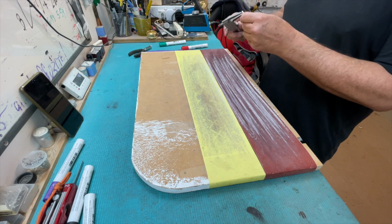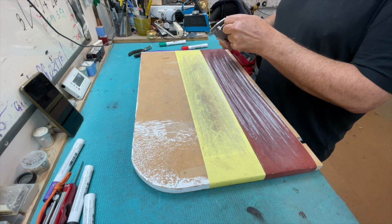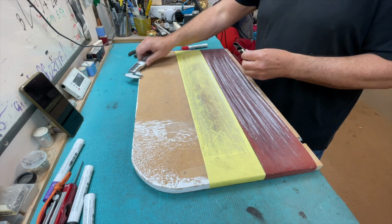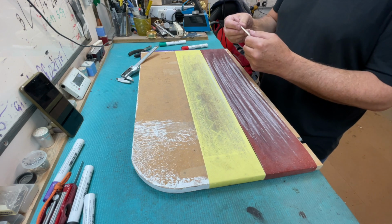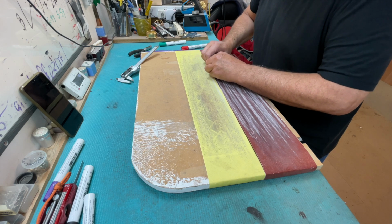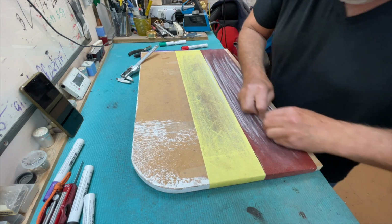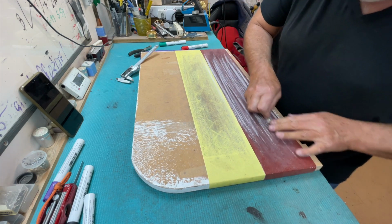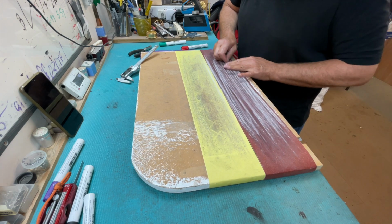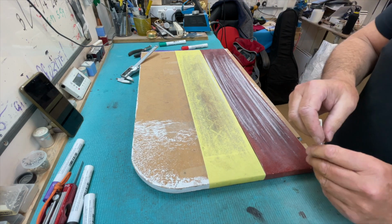So we were going to 548 on this side, that's the target. 596, we're getting there. On this side we're going down to 743, but it's at 699. So we've got a bit more distance to go, which is absolutely fine. It's better that this does it slowly rather than quickly. But remember, we're only going halfway in this first bit, and then we'll assess it from there on. Of course, if it doesn't work, we can always rebuild this or put another saddle in that's taller.